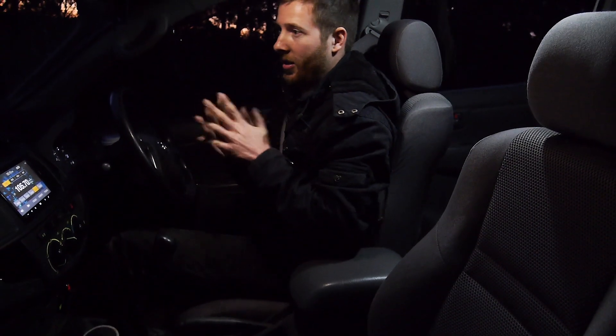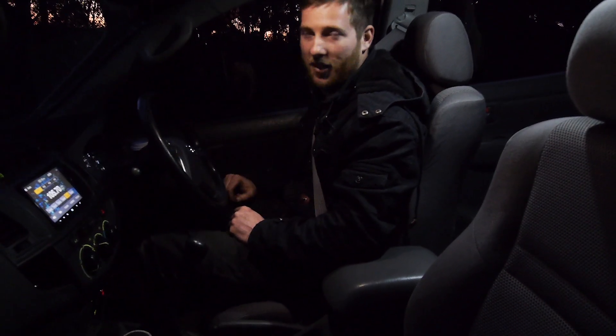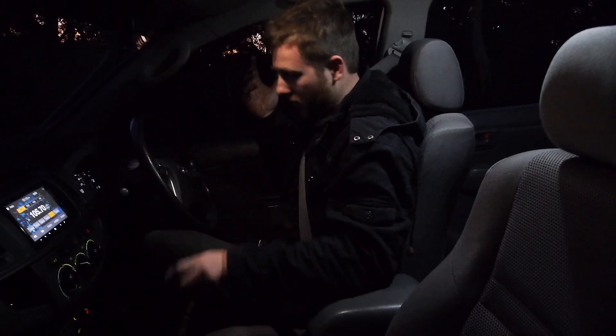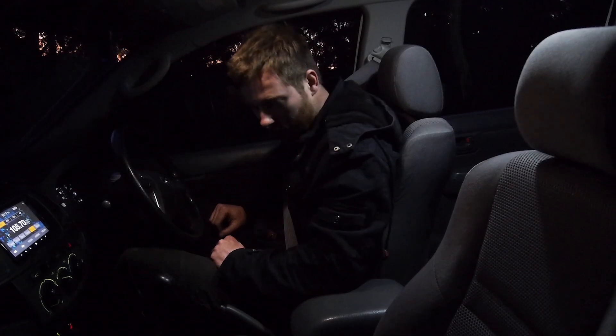Alright, so we're at one of my test hills. This hill is probably one of the steepest that you'll find in Sydney or on any kind of public roads — it's about 16 to 17 degrees, which is the max you'll get on public roads. I'll pull the handbrake on, put it out of gear, foot off the brake. It'll lurch forward for a sec until the drivetrain slack gets taken up. As you can see — foot off the brake, out of gear, car running — it holds just fine. As I said before, once you get it adjusted it should be sweet for a lot longer than your drum brake setup without having to adjust it again, because it is only used for your handbrake and when you're using your handbrake the pads and the disc aren't rubbing past each other wearing. So it shouldn't really wear. As you can see, it works.